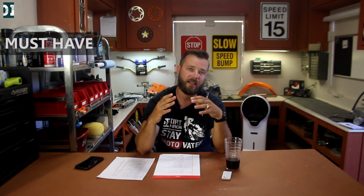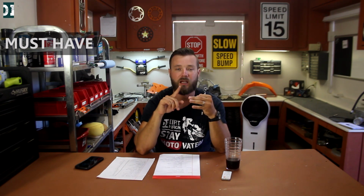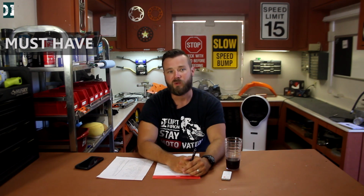And since he already has the engine and he's working on the top end, I decided to go the whole 9 yards and also do a complete bottom end rebuild. So I got brand new Hot Rods cranks, main bearings, all the seals and everything. Once Eric is done with this engine, it will be so sweet. It will be like a brand new engine, and I can put hundreds of hours on it. Maybe just swap the piston every 100 or 150 hours, depending on how it looks. But the bottom end, I know it will be rock solid.